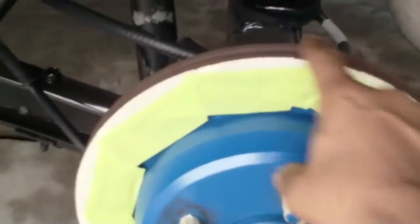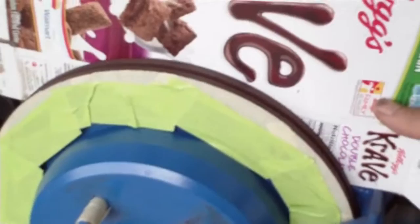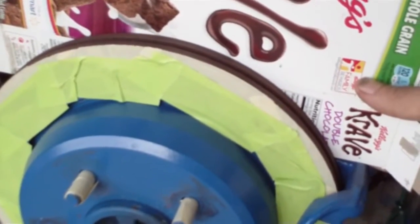I had two pins sticking out one side and one pin sticking out the other side. I decided that since I'm going to have the caliper off anyway, I might also take this opportunity to actually paint the edge of the disc brakes. I didn't do this before because I didn't realize it would show that much through the rim. But after I got the wheels back on, I realized — oh, this part shows — that was the last little piece of rusty part left on this whole setup. If you're wondering what that cereal box is, I just taped this front part of it. My plan is to hold it back here so paint doesn't get on the back side of the disc, and then paint that little edge.